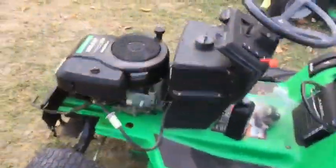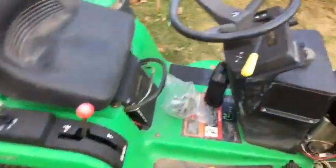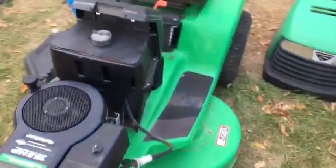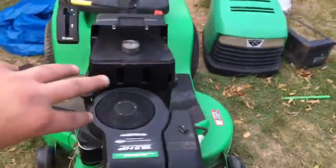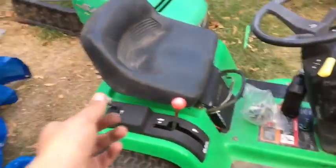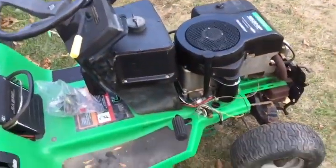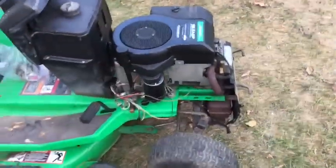Thanks for watching. Here's another little project I forgot to film for you guys. Basically, this mower is an early 2000s Sabre, 15.5 horsepower, 38-inch deck. Bought it — owner said it didn't work, couldn't get it to start because it would turn over and get stuck, and then the starter couldn't twist it over. So new starter, new solenoid, new ignition switch — that still didn't fix the problem, so the motor came off and it was a compression relief on the camshaft, which I replaced. Now everything's finally back together.